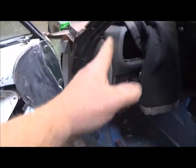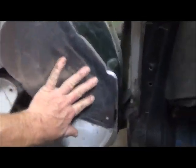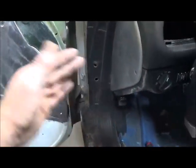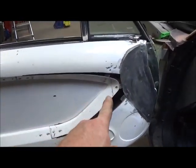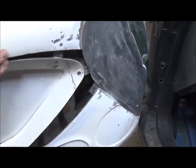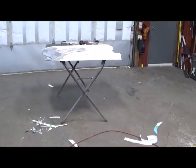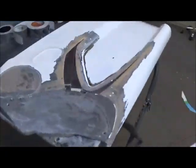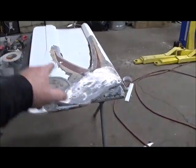I'll show you this door panel — I've been trying to design how I want it to receive the end of the dash, which kind of sits in the door panel. I've made it concave and shaped it so it houses the dash about three-eighths of an inch in between. I'll put glass over top of all that, then cut it loose and moved it back. Here's the door panel and I'm fixing to do my glass overlay on the outside, so I'll actually mount this on the car.